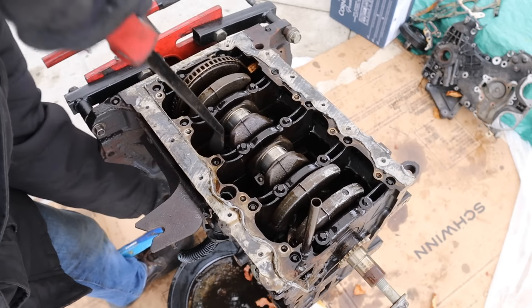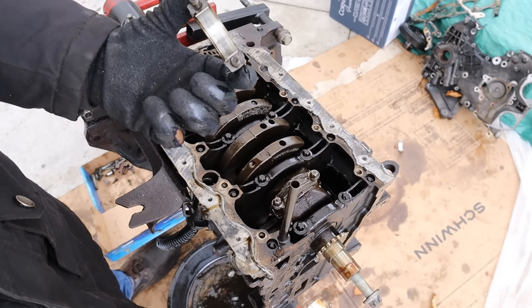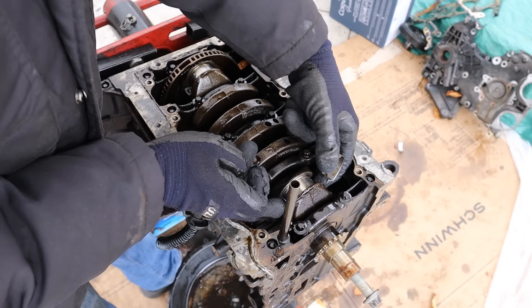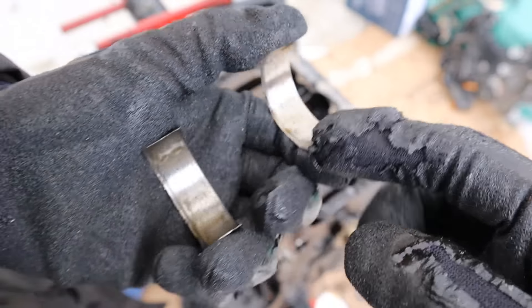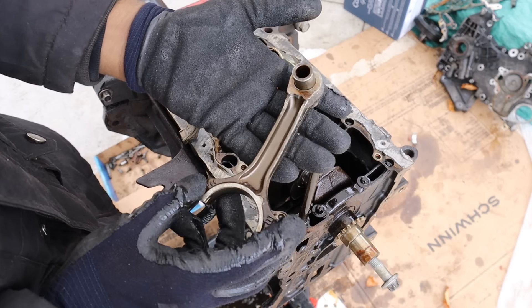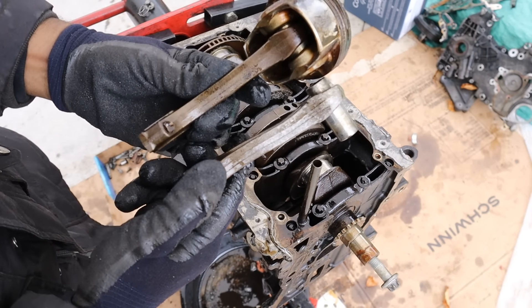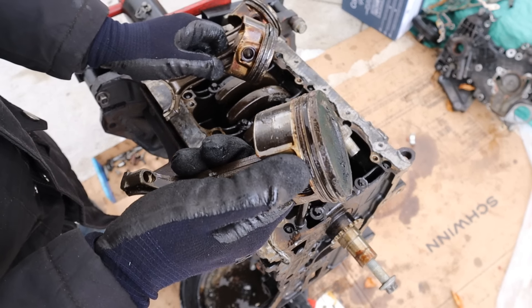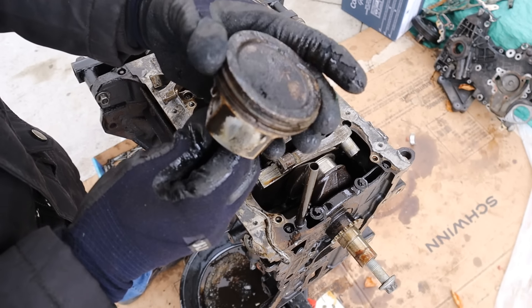I'm going to push the piston out of here — piston number two. I'm going to remove piston number four. Connecting rod bearings are the same. Now this one is the failed one — it was already loose. Peel this bearing off here. This is the bearing off of piston number one — you can see it's flattened around the edges. Connecting rod number one actually fared okay — it's not obliterated or anything like that. It is bent though. Taking a look at the piston tops, or at least what's left of them, the oil control rings are kind of clogged up, which means the engine was probably burning a little bit of oil. Not surprised if they actually ran the engine a little low on oil.